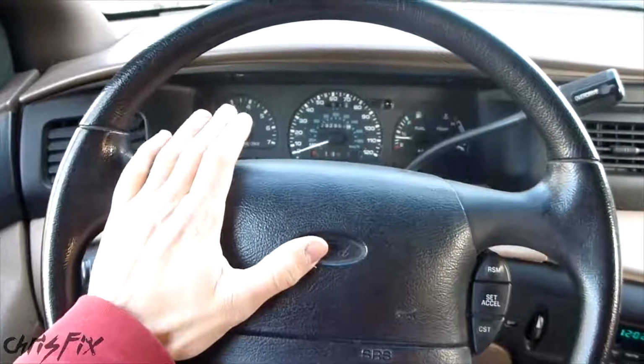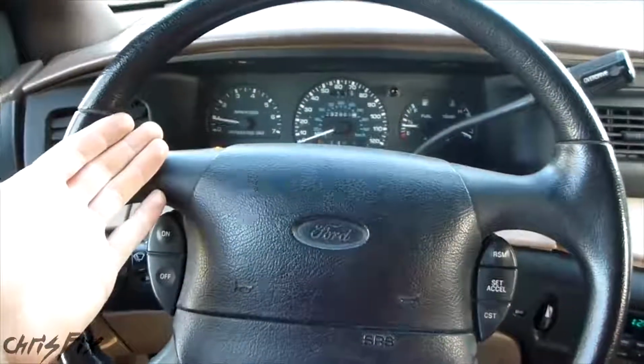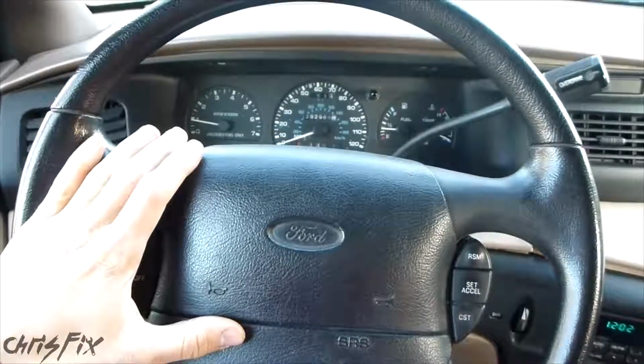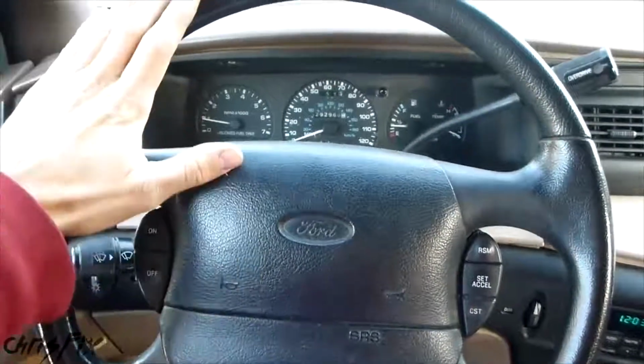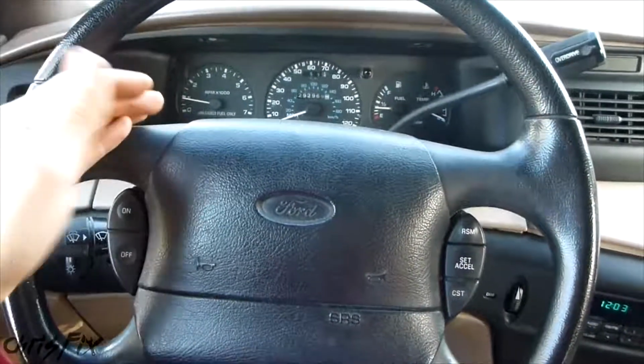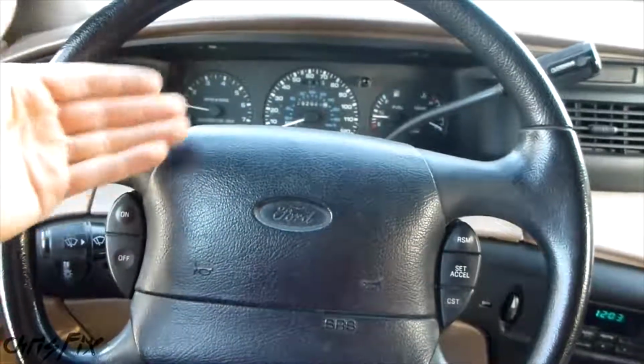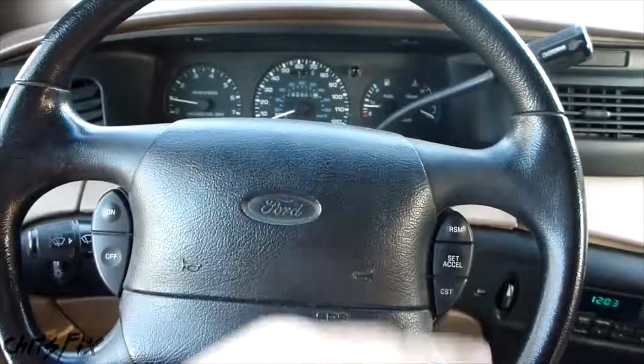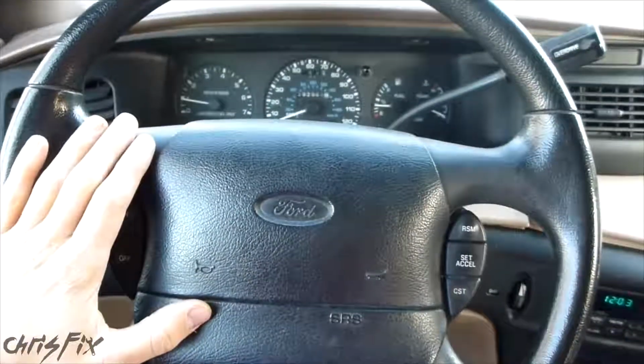So let's just give a scenario where you go to start your car and it doesn't work. It slowly drags, but you don't get the car started. Let the car sit for another 5 minutes. Let that other car that's running charge up your battery. Essentially, the alternator in the other car is charging your battery, so sit for 5 more minutes, take the key out of the ignition, and then in 5 minutes try starting it again.